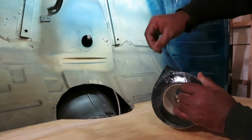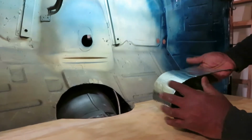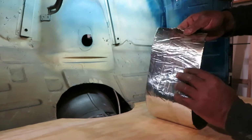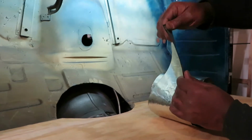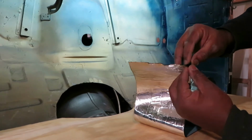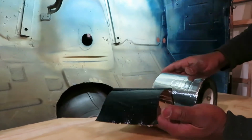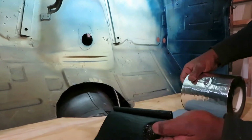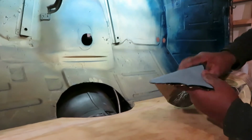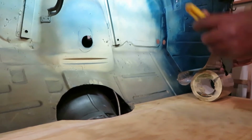You just basically take and you peel it off like this, and it's got a metal on the outside, and this is how it's thick. And on the inside, it has a little plastic covering that you pull off, and this part sticks up on your firewall. So what I normally do is I like to try to measure a few before I cut them. And I'm gonna go all the way up here with the firewall, get your good X-Acto knife.